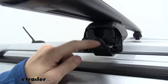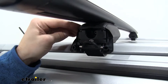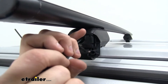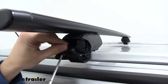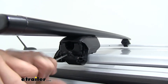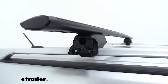Now we're going to tighten down two different bolts. The first one is going to tighten down our strap against our raised side rail, and the one on the inside is going to tighten down our Timberline tower to our Jetstream crossbar to make sure it doesn't move at all. It doesn't matter what you do first — just get them both done. Once you get the first one nice and snug, move on to the next one. As you tighten it down, keep going until you hear the audible clicks from our tightening tool — once you hear those, you know it's tight enough. Grab our end cap and put it on.